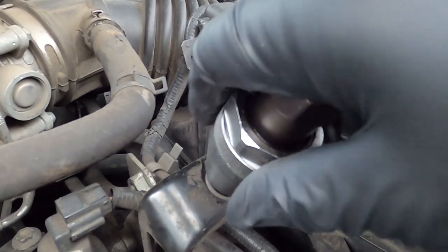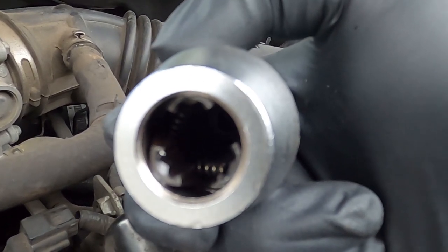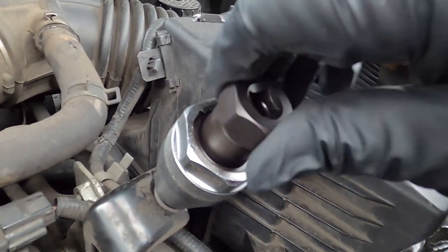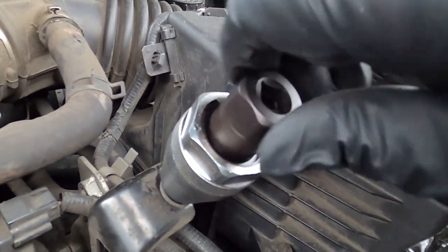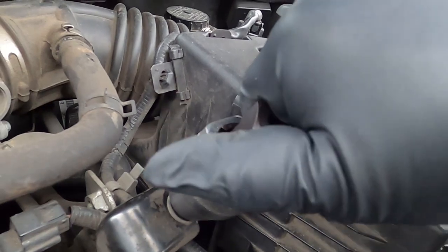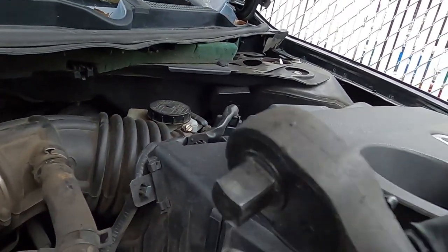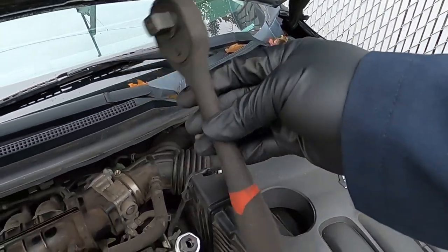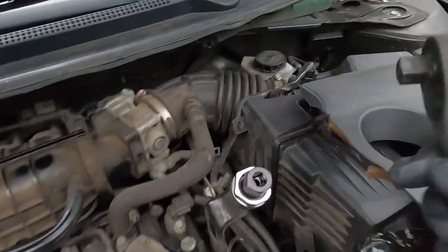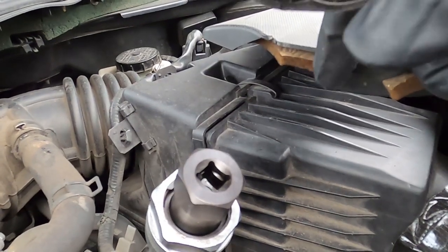Let's take a look at how this works. You can see there are three little prongs with teeth on them inside that get tighter as you tighten it down. It goes right on top of the bolt. Turning it clockwise opens up those teeth, so to tighten it down you turn it counterclockwise. Now it's gripping nice and tight. Next step is to use my socket wrench — I'll need an adapter so I can use my longest heavy-duty wrench — and I'll continue to twist counterclockwise. It should get tighter and tighter until it breaks the grip of the bolt and screws it right out normally.